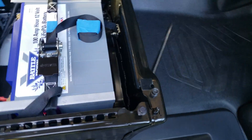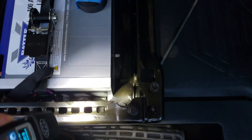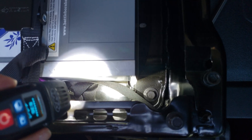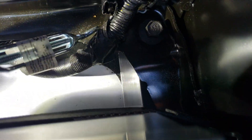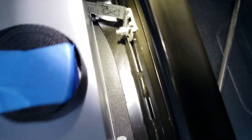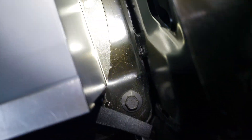Come around here and I'll show the attach points. The strategy was to bias the battery into this corner, right here on the frame, oriented north-south. I put the aluminum bar in here — the channel is resting right there. I just inserted it east-west under the seat pedestal and it fit in there perfectly; I didn't have to fasten it at all, just slid it in. The reason I did that is I didn't want the battery touching the arc of sheet metal along the bottom at the corner, which would have been sharp and left impressions into the battery.